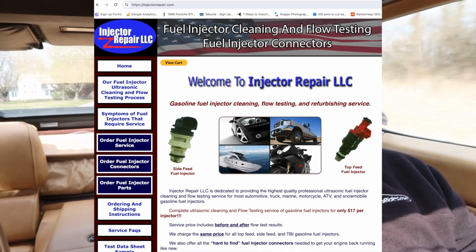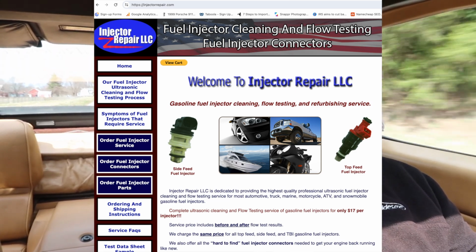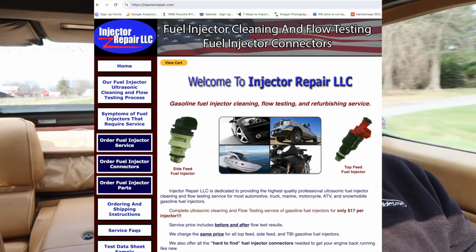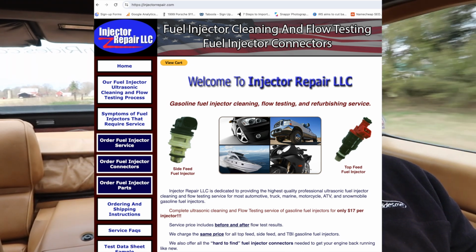Chris from the Porsche Club, Fred from the Porsche Club, recommended a company in Schenectady. They have a service that you can send out. They will electronically clean your fuel injectors. They will send you before and after flow rates, and then any recommendations if one needs to be replaced. They put all new O-rings in and a micro screen, and they do everything.